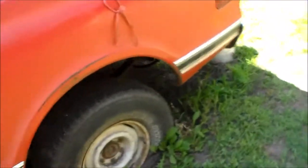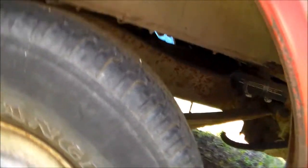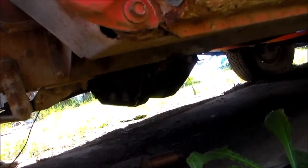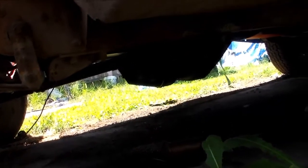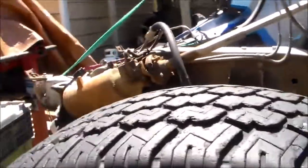Now my plan is... I didn't think this part through, but you can actually jack it up and put the jack stand right there on the back. And on the front, right there just between the cross member that holds up the transmission and transfer case — that front mount will do just fine on all four corners, and this thing will be up in the air.